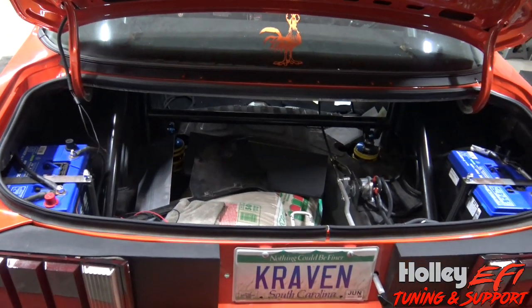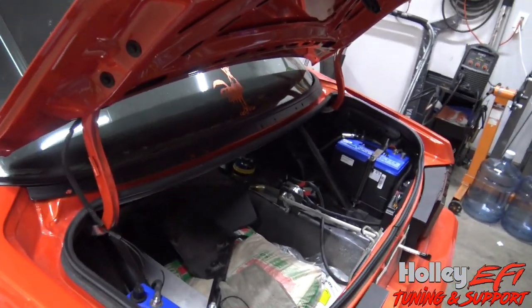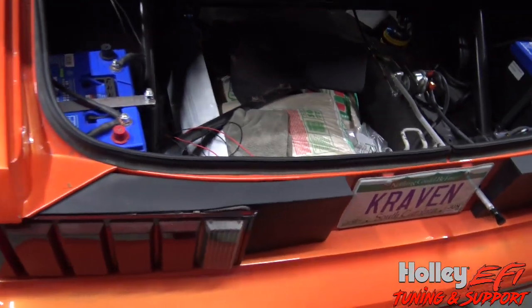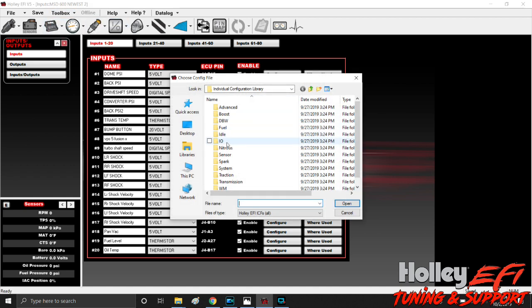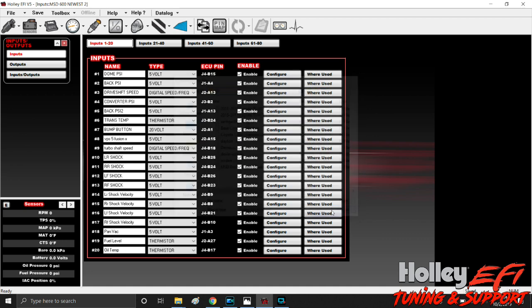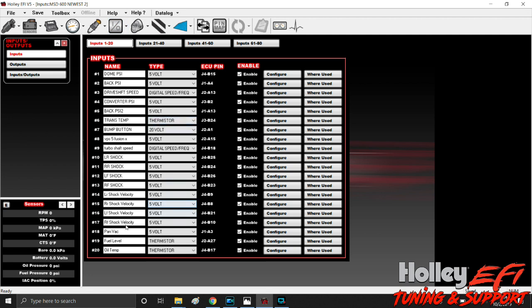On this one I ran a wire from the sensor ground back to the ECU. Now I'm going to show you on the software on the laptop and then on the dash. Here we go — we're putting together a fuel level gauge. The first thing you need to do, if you don't already have the input/output ICF enabled, is go into Toolbox, then Add Individual Configuration, scroll down to I/O, and click on demo, blank, or base config — whatever you want — so it'll populate the Input/Output tab.